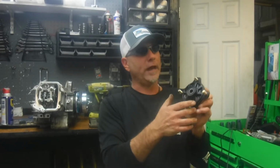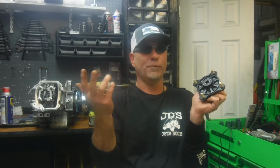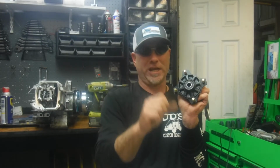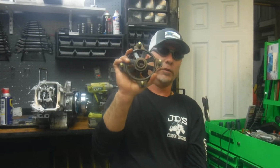Okay, so you might be able to manipulate using bearing sizes if you needed to make one fit another. But 4 on 110. Now, for those who don't know, how do we come up with what 4 on 110 means? Basically, if you go diagonal from stud to stud, it's 110 millimeters, or it comes out to like 4 and 5/16 inches in change, but it's 110 millimeters there. On this one, from center to stud across, going diagonal, 4 on 137. Okay, so that's how you come up with that measurement.